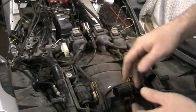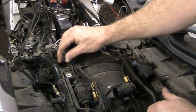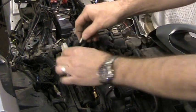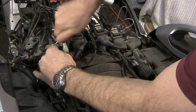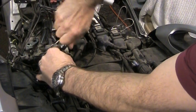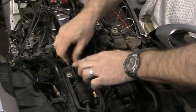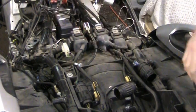Now I'm going to take a zip tie and zip this back down because I had to cut that one out to get to this junction. As you can see, it's just routed right through here now. This is missing. It'll just route out now. So if this thing does push gas through here, the gas is going to drip down behind the bike, just like on any other bike. Now the only thing left is to go ahead and plug this thing up. I'll just thread this bolt in there — that'll be good enough, it's not going to fall out. Then I can zip-tie that right to here too. That's the canisterectomy.